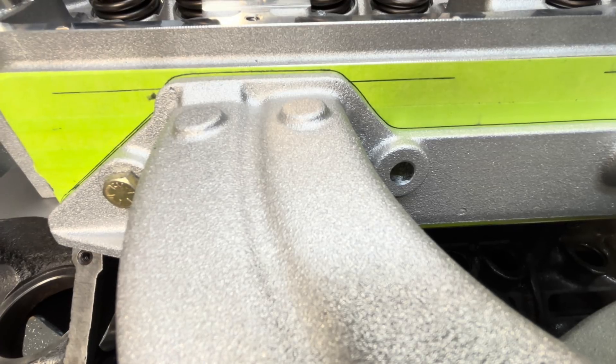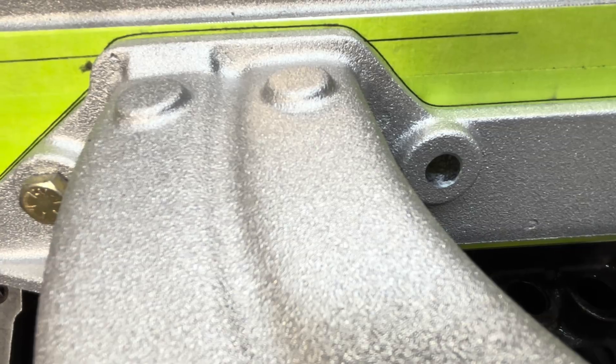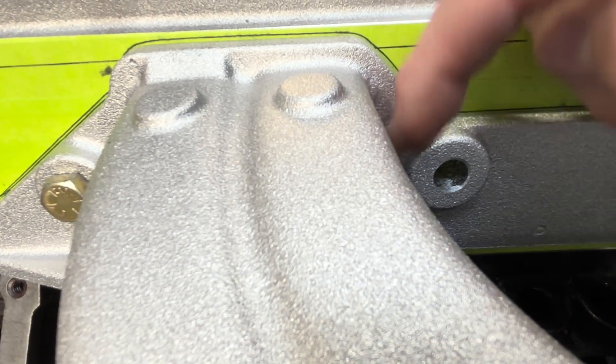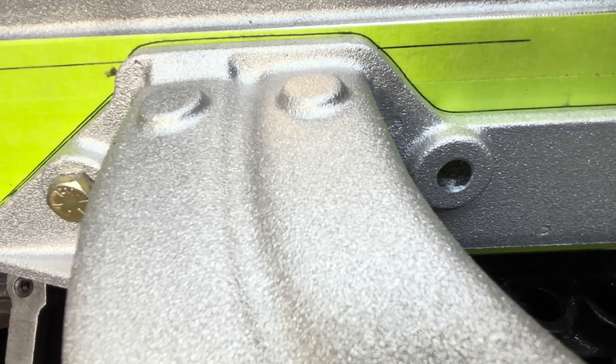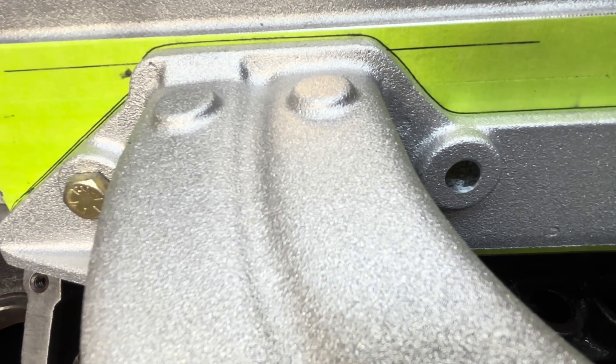You'll get to see the difference in how much taller the head profile of the 270 is versus the 240. I never removed this tape from this head, so I wanted to use it for an example. We know right now the thickness of this runner is 225 thousandths — less than a quarter inch. We can port it into that and get closer. Whenever you put gaskets on here, 270s would take a plate to go under the intake. When we put a gasket on, it's going to raise the intake just a little bit higher.